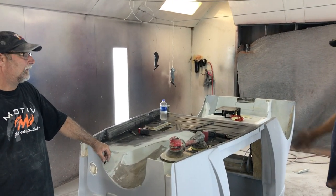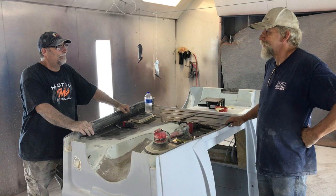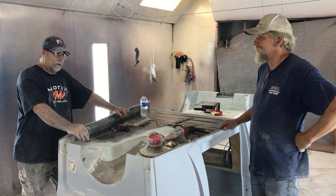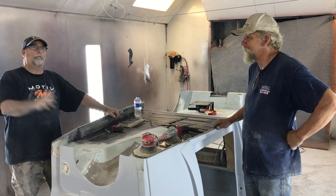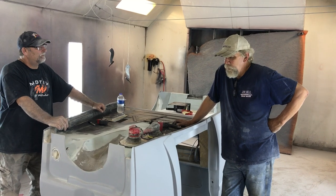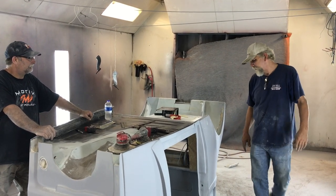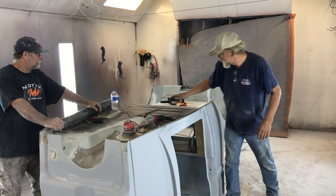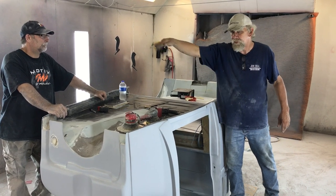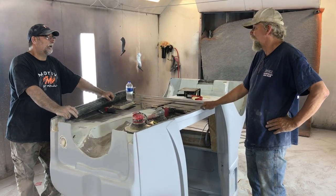What do you have to add on the detailing? Just a lot of work — hours and hours of blocking and blocking and blocking, just keep blocking. Prime it, block it. You still find mud coming through. It just takes time to get it flat and straight — well, there are a lot of radiuses on here. When you're looking at a car like this, I use the light. So if I look even in the primer, you can see the light reflection, and if it's wavy or has a hump, that light will take the contour and it won't be jumping up and down. So use the light while blocking. You use guide coat? I kind of went away from it.